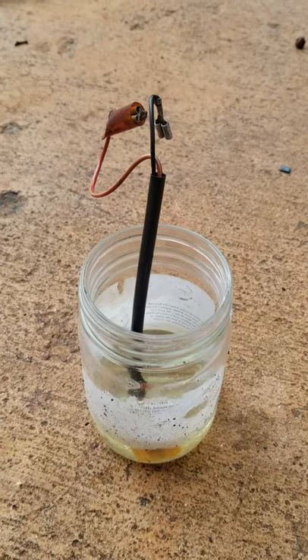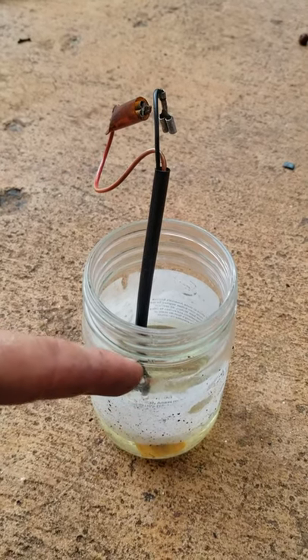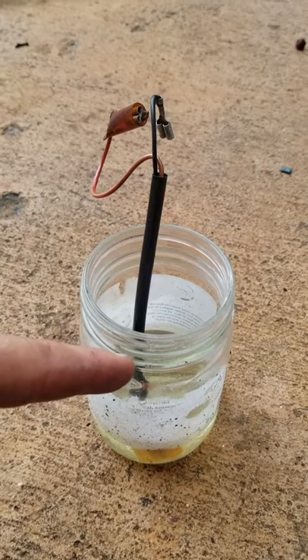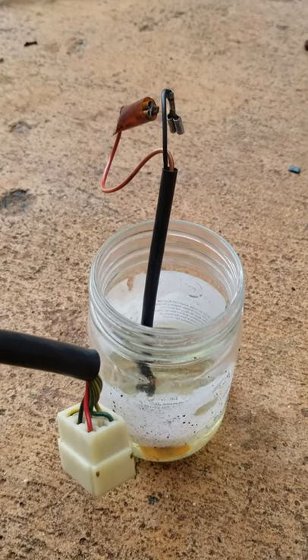All right guys, you can stop there, but I'll take it one step further. Right here I got a solution of liquid tin. I'll post links in the description where you can get the stuff on Amazon, or you can just search YouTube how to make liquid tin. Basically what this is going to do is tin plate our copper connectors so they never corrode again. We're going to stick this thing down in there, let it sit five minutes, pull it out and blow it out with air, and it should look exactly like the thumbnail.